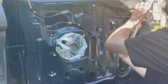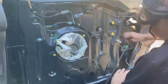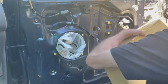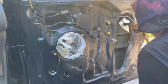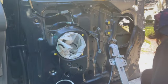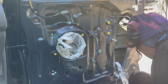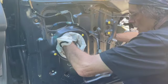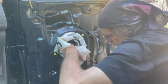I left a couple of the bolts in just so I can see where they go on the new regulator. For Honda and Acura, the regulators come with the motor — you don't have the option of getting them separately; it's going to come as an assembly. About three of the 10 millimeter bolts can be put on in advance, which allows you to line them up and hook them in to hold it in place.